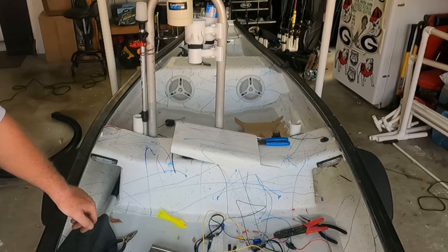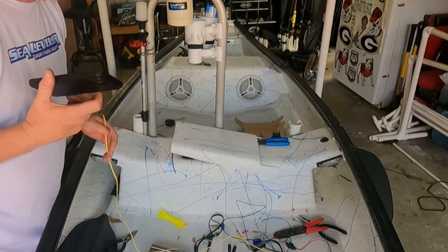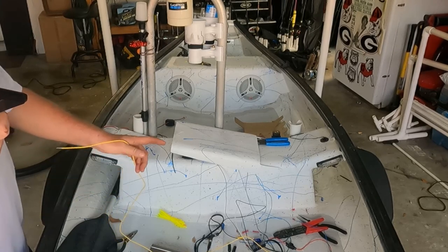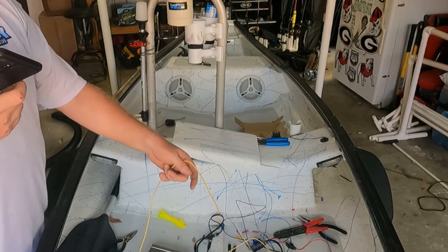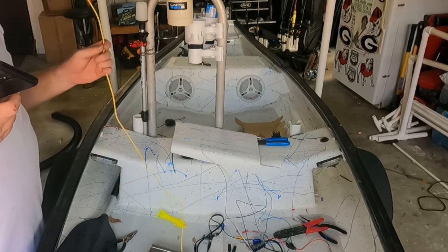I just had a brain fart. What's that? So which wire gets the inline fuse, the blue or the yellow? Yellow. Yellow gets the inline fuse. Yep, the blue is gonna be your toggle. Yeah, I got the red wire from the receiver and the blue wire from the pigtail going to the switch. Correct. And then your inline fuse will be on the yellow on your amp.